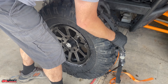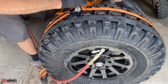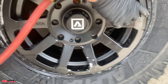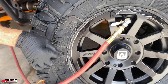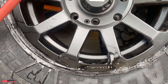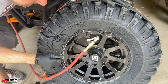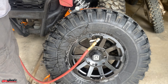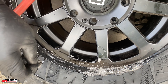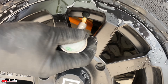Now we're going to watch the bead — watch the tire pop onto the wheel. This tire says 35 pounds max to seat the bead, so we're not going over that. We just heard the rear one pop on. Don't be afraid to pop the air off and check it with the air gauge. Air is still building and the tire is popping on — looks like it's about to come on, but we'll stop and check just to make sure.